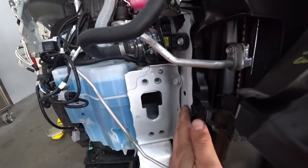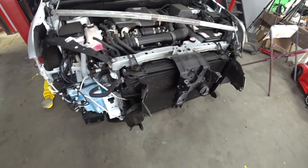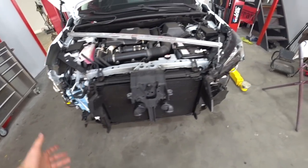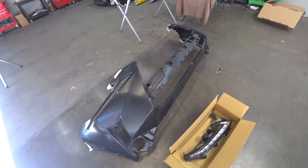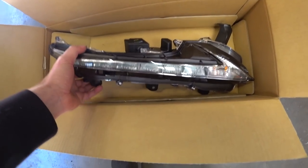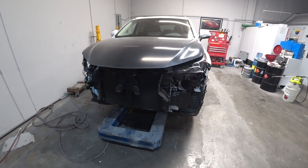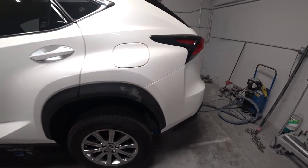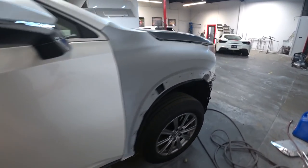We need to pull it back — you can see right here it's kind of pulled. It looks like I missed the frame and just got this soft spot. We'll pull everything back and then install the light and the bumper, make sure all the gaps are perfect, and we're good to go. We got a couple more parts today — a bumper and one fog light came in, so we can start working on the Lexus. The Lexus is all secured on the frame machine, clamped and ready to go. We'll start pulling the car — just got to pull the front end a little bit.